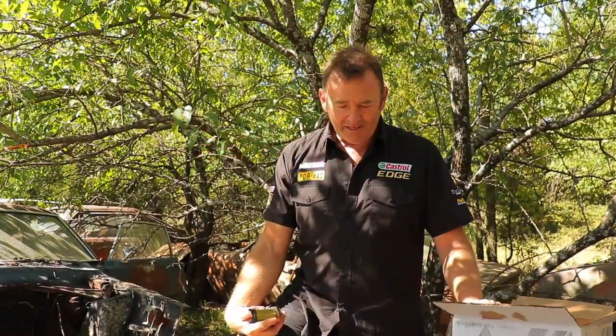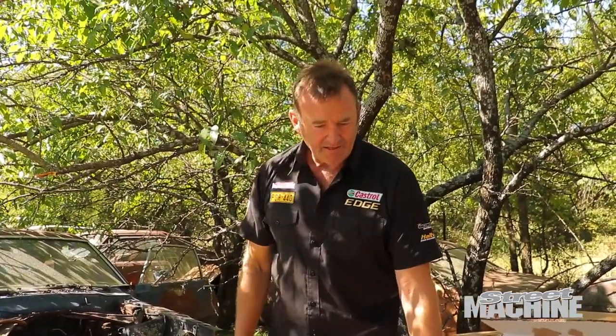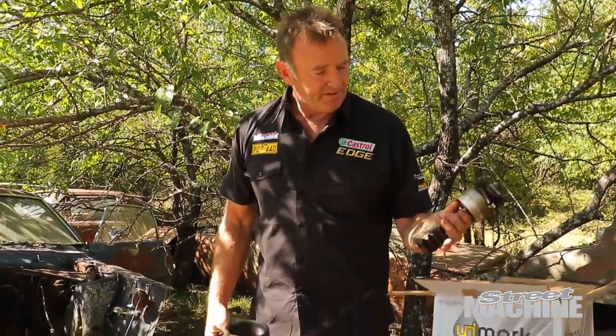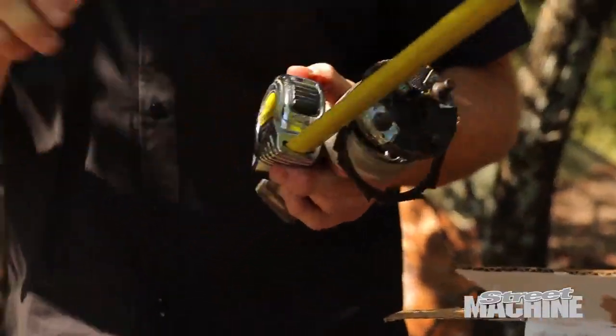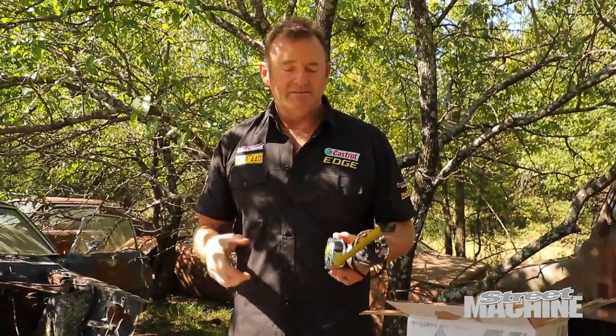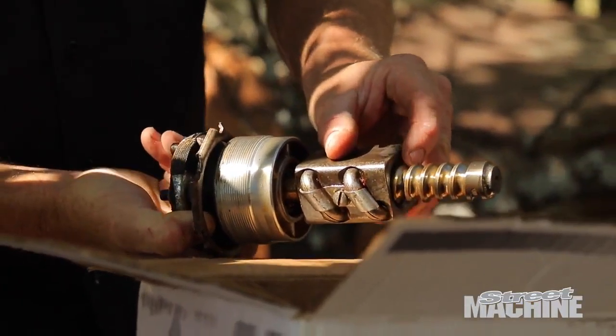The only mechanical part on the car that didn't get pulled apart, when we pulled it apart, it wasn't good. It was messy. So yeah, the worm, it's sat in water, and so the worm is really badly pitted, and it's really notchy. So when you're driving, it'll be okay there, and then when you turn it a tiny bit, it'll take a big leap to one side. So yeah, you see all the chatters.